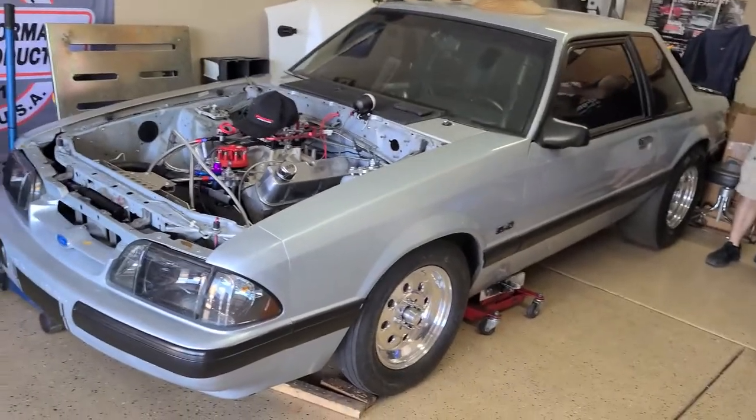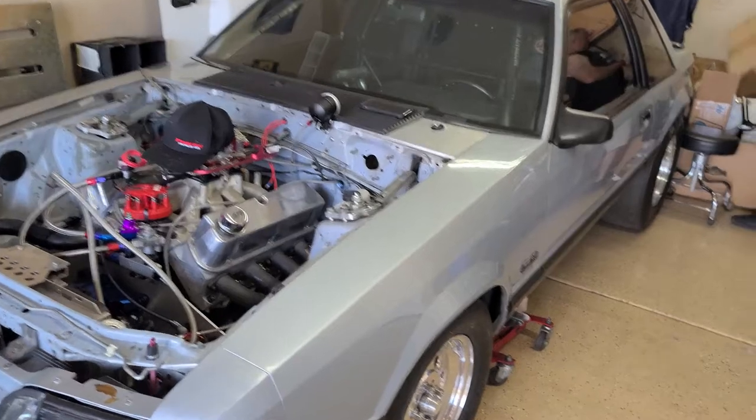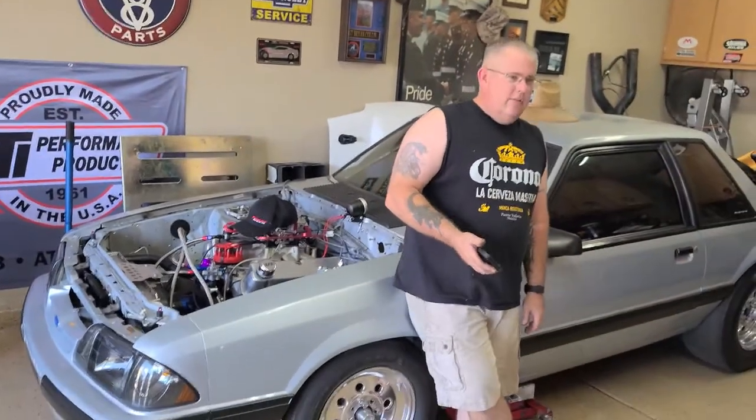It's back on the ground. This is starting to turn a little bit into a situation — are we ready to start it? No. When you call JEGS up to order a flywheel for a car and you don't give them specific parameters like what bell housing you're going to use, they just send you a flex plate. Well, the flex plate that's in the car right now is wrong. The only reason I know it's wrong is because the starter wouldn't line up right, so I called JEGS back, and after I ordered it the guy gets on the phone a month later and goes, 'Yeah, that flex plate's wrong.' Why did you sell it to me? So I had to order two-day air on a new flex plate.